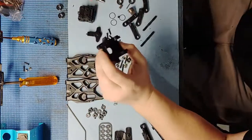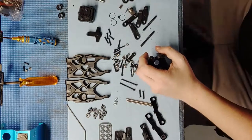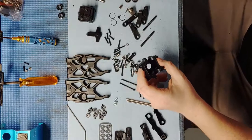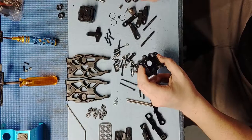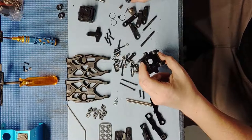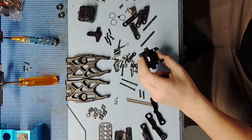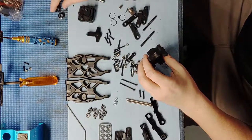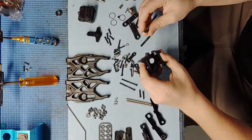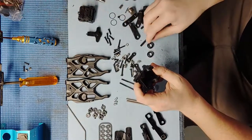Assemble the pinion. So here's the scoop on these pinion bearings. If you only upgrade four bearings on this entire car from stock, it should be the pinion bearings. When I got my test kit back in October and did some testing, these bearings failed and ruined the ring and pinion. So I would suggest upgrading these so you don't cost yourself $50 in diff gears. Sendo RC has a very, very good bearing kit for this car. And J&T Bearings is what I've been using the past 6 years. I use the J&T NMB bearings, and they are absolutely awesome as well. So I would suggest upgrading those bearings.